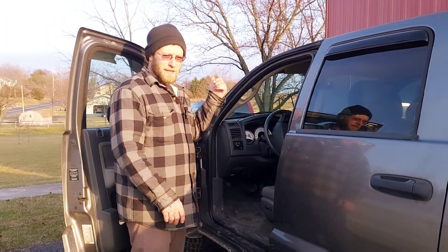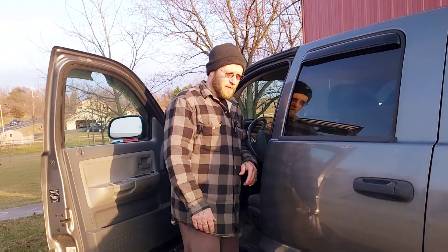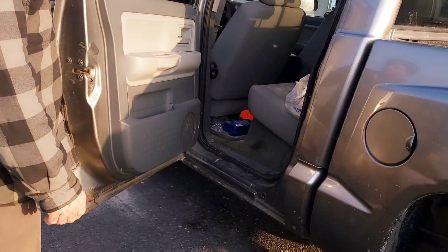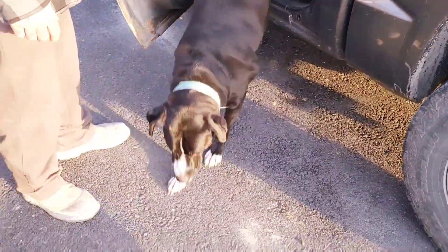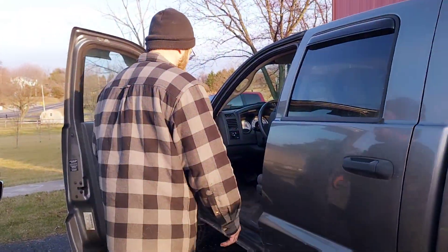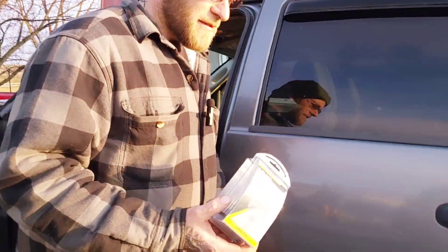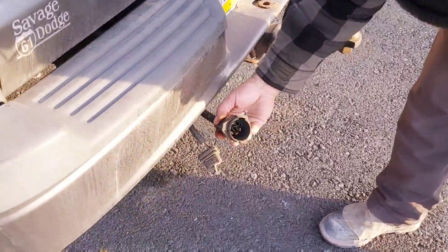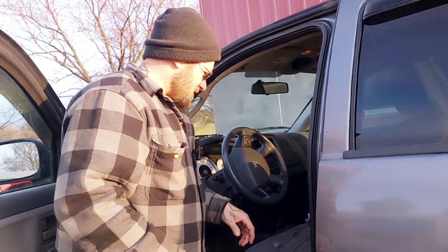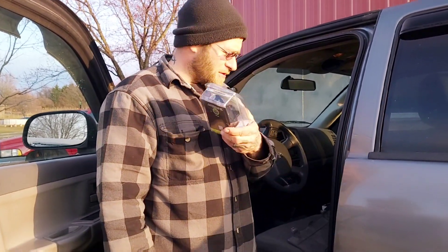I'd normally like to take the big red truck when I'm pulling the trailer, because the trailer is not too light — I think it's about 2,500 pounds. I have a rogue dog who likes to get in and enjoy trips herself. Anyway, I'm having to put a new trailer plug on — as you can see, this one has seen better days, a little corroded, missing the brake pin. This thing originally had the towing package on it, but it's seen better days, so I got a new plug to put on it.